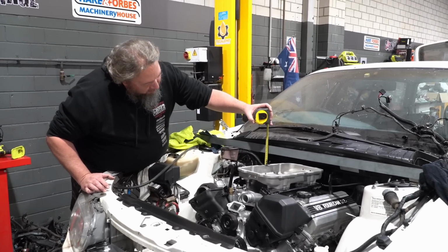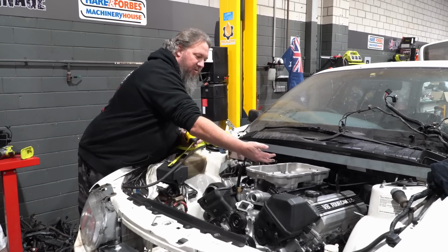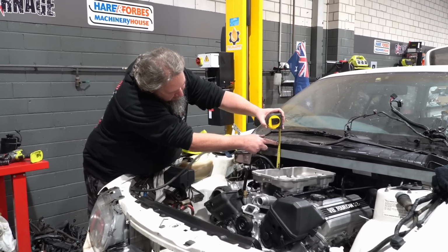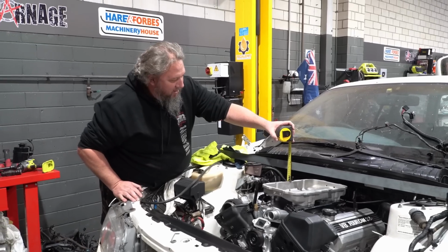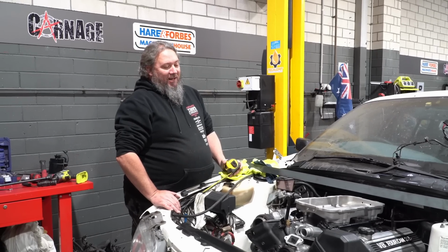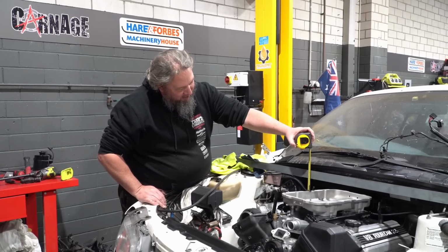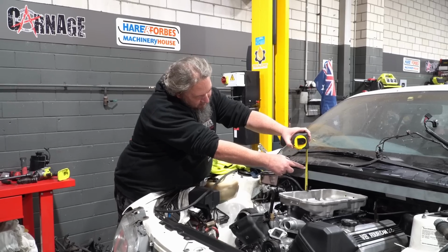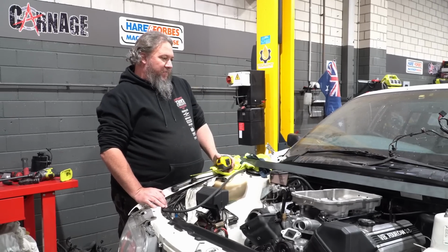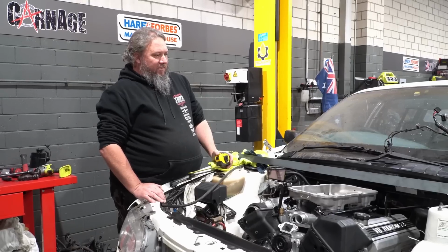Okay, so we've got 63 mil from that flange, that face, to the bottom of this. I need 125, which is up here. And I just don't think we can make that happen. Even assuming there's a curve in the bonnet that may give us an inch, let's say 2 inches, that plus 2 inches gets us to what, 110, 115 maybe? I still need 10 mil. But we could put a slight bulge in the bonnet. Wouldn't need a full reverse cowl. Just need a bulge.